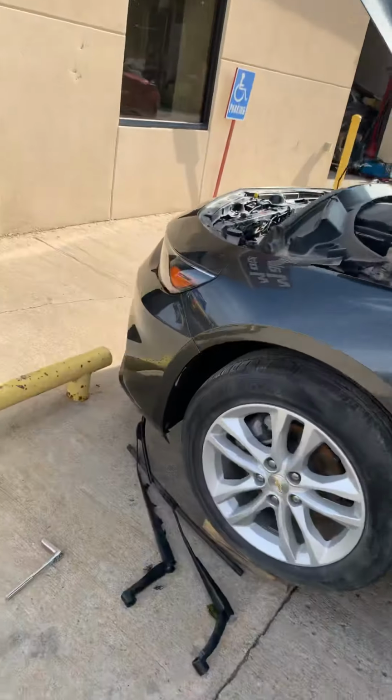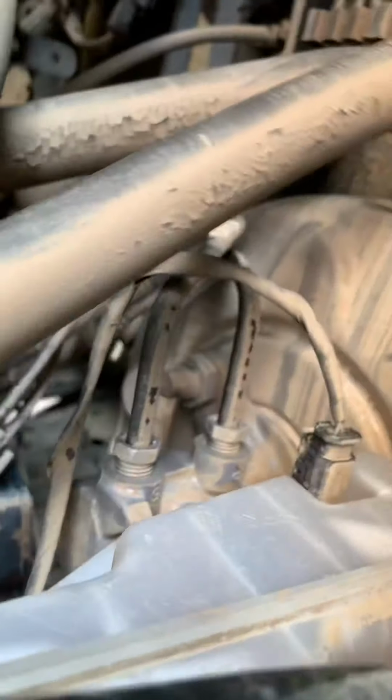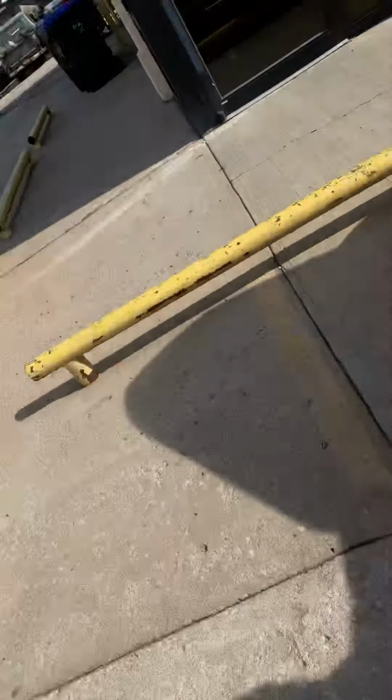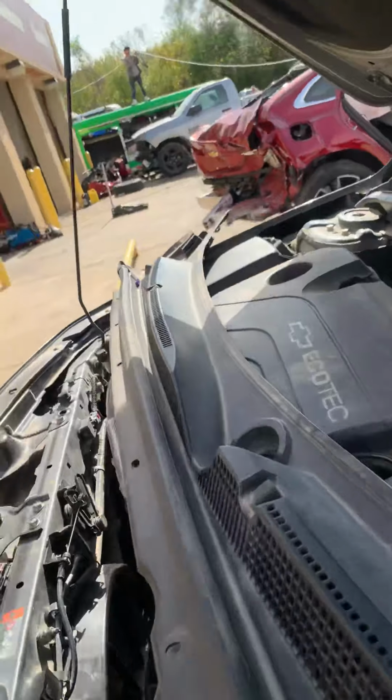Anyways, I'll show you where those bolts are in case you want to take off the complete brake pedal. Right there on the brake booster one, and underneath the master cylinder, and then there's another one. Those are 13. But anyway, let's get to work, guys. I'm gonna start by taking this back, back of the dashboard or the front of the car.